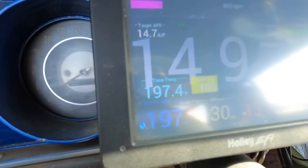Okay so we've got a bit of a dilemma - it's not the end of the world, but the transmission is hotter than I like it to be. What's happening is my fan is kicking off because the motor cools off and it's like 'oh, we're fine.' This is the same thing that happened in the Twinnebago - it's just leaving my poor transmission hanging out to dry. We'll tickle the old keys on the laptop and adjust that. My buddy is not here to return the tool, so we pulled over and shut it off to mess with the laptop.